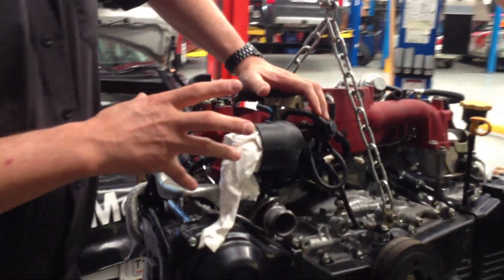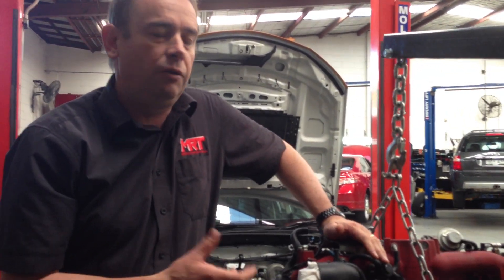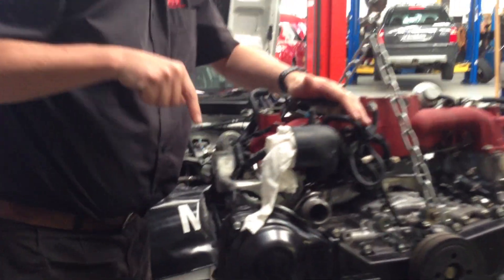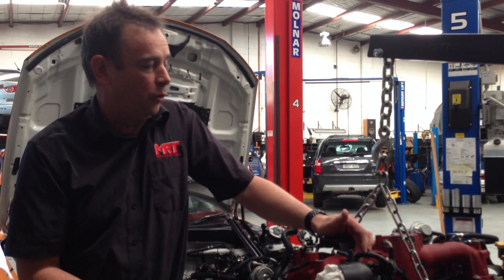This engine is designed to run on E85. E85 consumes about 30% more fuel than 98 or 100 octane fuel. Down inside here — I'll get my cameraman to poke the camera in right there — is the injector. We're going to a larger capacity injector which gives us the ability to flow more fuel to meet the engine's demand requirements, allowing us to generate more power.